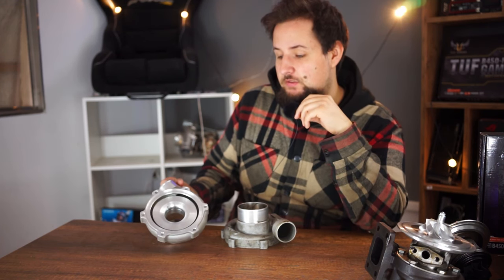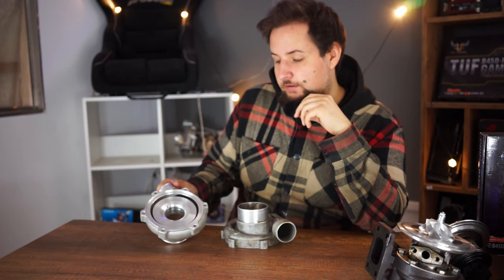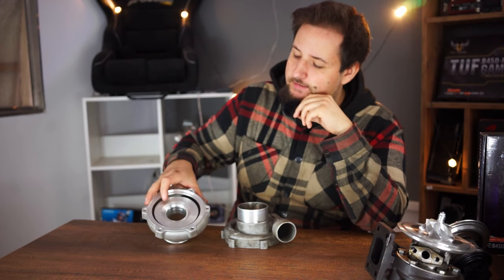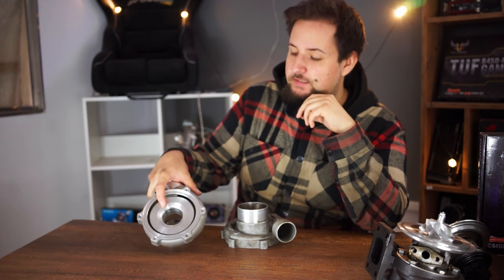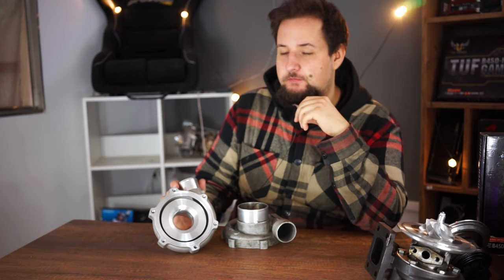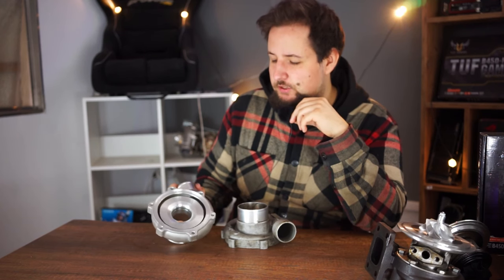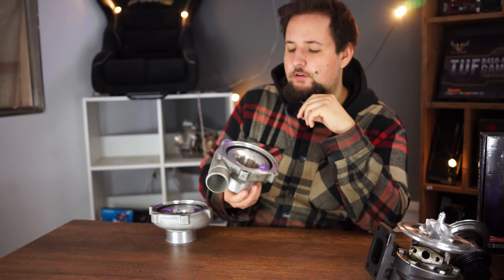The air is rushing over that bolt hole and creating turbulences, therefore creating noise — this is where these noises come from, and that's why these turbos sound so wild. If you want to make that sound more aggressive and you have a Pulsar unit, for example, you can put a spacer between that bolt so that the bolt does not go as far in and stays a bit further back. This does not impact performance in any way — you might lose one or two horsepower, but that's not really an issue.